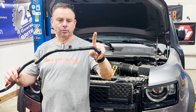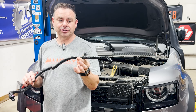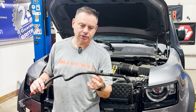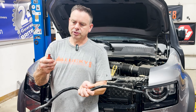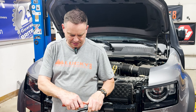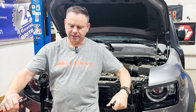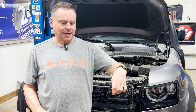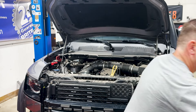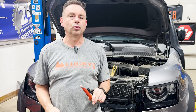This is what the hose looks like — we want to keep this small piece with the T. Essentially this plastic tube is heat-shrunk on there, so if you're brave you can warm it up with a little torch and it'll slip right off. I'm going to use the old-school method and just take a razor knife gently a bunch of times until it goes through and comes loose — job done. Now we're going to take the new hose, clamp it here, run it down with the other quick connect from the other side, and the cooling system will be back in place.